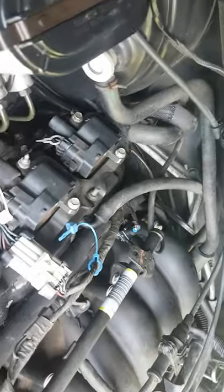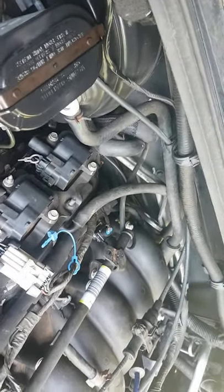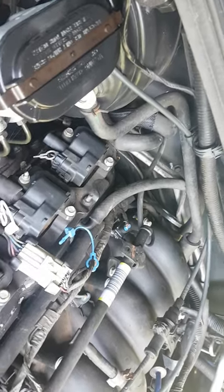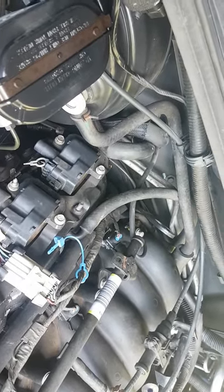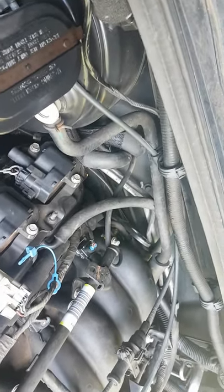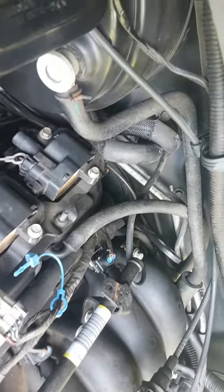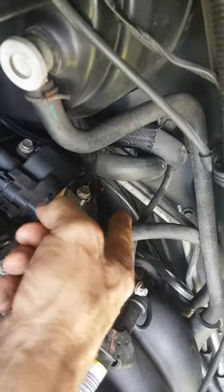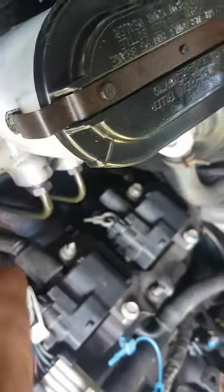Then for this side, you need to come across the top of the gearbox from under the car, with the back of the box dropped down once you've taken out the cross member. Then you can come over the top of the box with a mega long bunch of extensions and a rattle gun, and just rattle out the one about there at the back, and the next one down, and the next one down.